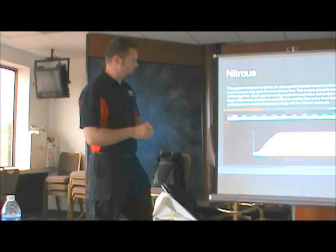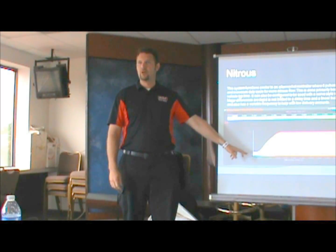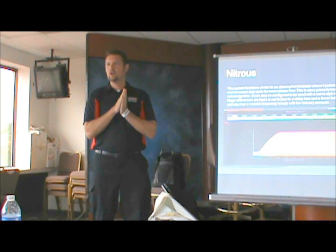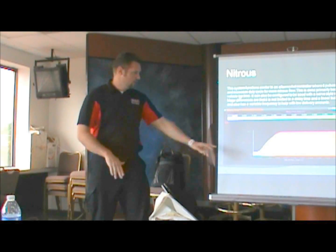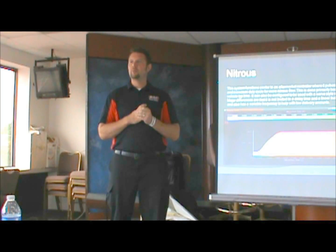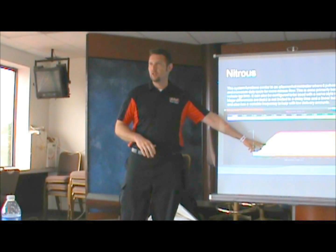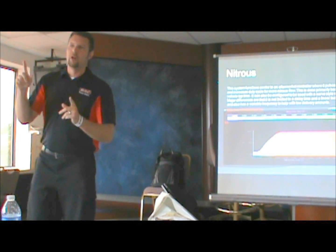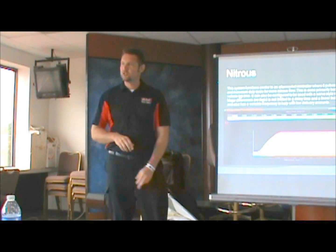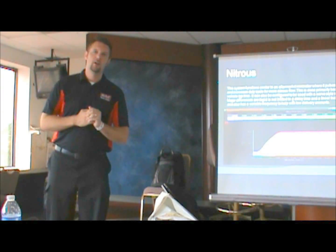The really interesting thing about that, and what I've tried to show here, is we can actually hold our nitrous flat at a small duty cycle for a period of time, which is really helpful for the non-wheelie bar bikes, where you just give it a little bit of power, you hold that amount of power, then when you have enough wheel speed to pick up some more, you start ramping it in. On a standard delay time and build time system, you delay it, no nitrous, then you turn it on and you ramp it sort of linearly like this throughout that build time. So what we can do now, and this is the most important part of it, is bring on enough nitrous that the bike can handle, hold that, and then ramp it in and control torque versus lap time.